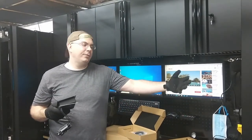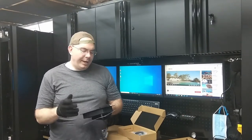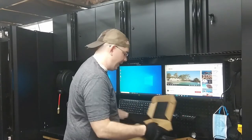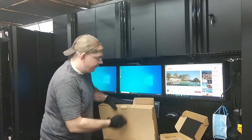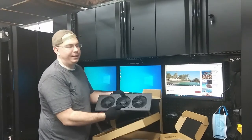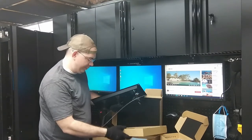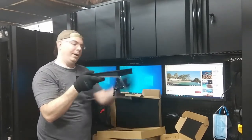The PC is pulling air from the bottom side, it's going in, cooling everything, and then it's shooting the air out the top. So we're going to install one of these, the two fan system, for the air coming in, which will be just fine, and then we're going to install a larger one in the top to extract the air out. So we'll have a three fan setup, and this is actually overkill, but if I ever leave that computer on, I want to make sure that it's not going to burn my garage down. So this will go on the top of the cabinet, we'll cut the hole, and it's going to pull all the air out to the top.